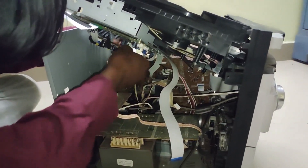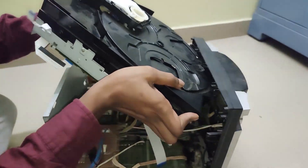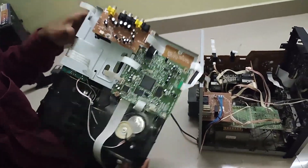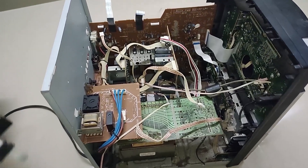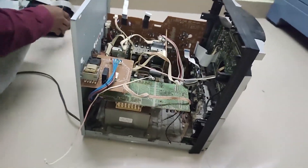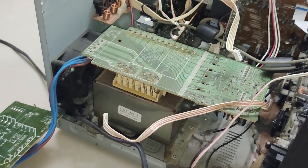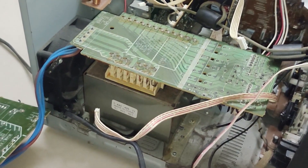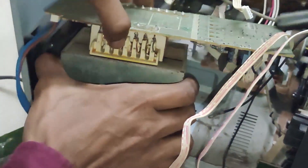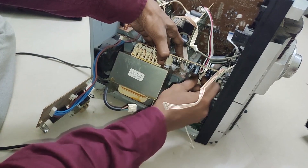The RAM IC that I was talking about is just under that board — some sort of DM8 or DMX8 board. It's underneath the carousel mechanism tray. There's a board there — see some sort of burned IC just to the right side of that giant IC. That's the RAM IC — it's blown out. Replacing that will fix this unit for sure; I guarantee you that replacing that RAM IC will fix such units. If it's a please wait issue, 99% of the time it's a RAM IC.